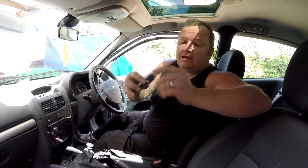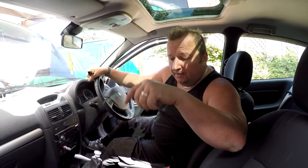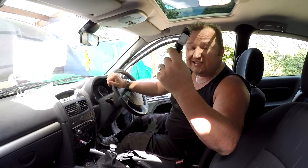I've just taken this little sensor out. As you can see, it's a little two-terminal device — you take two long bolts out, it lifts out, and underneath there's a plug you pull the connector out of. So we've now disconnected all three sensors on this side: the pretensioner, the thoracic airbag on the side of the seat, and now also the side sensor. We're going to connect the battery up and read the code reader just to make sure all three are now showing open circuit. We're particularly interested in this one — if it now shows open circuit, we know this is our problem, as it was initially showing as a short circuit.